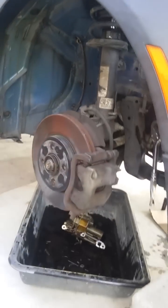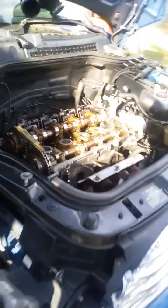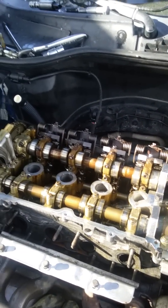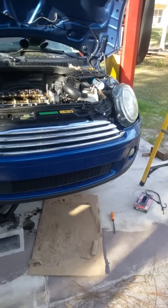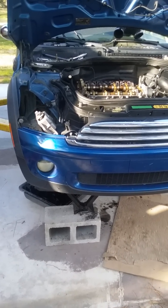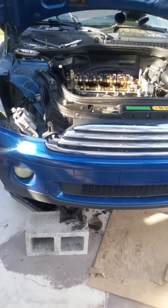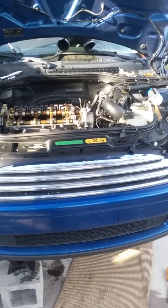Here's a summary of everything removed: the inner fender, tire, oil pan, valve cover, intake manifold, exhaust manifold, thermostat housing, and a couple of electrical plugs. The throttle body doesn't have to come off — just move it aside with the intake manifold. I did not remove the bumper or the driver's side headlight, only the passenger side headlight to access the motor and motor mount. I also had to disconnect and lower the exhaust to free up the exhaust manifold. Good luck and have fun!